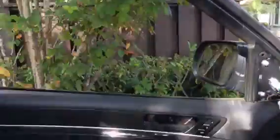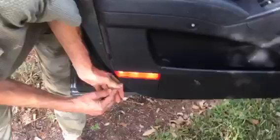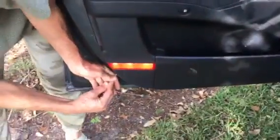That speaker comes off so you can lift the door panel. Take a screwdriver and pry the door panel off, then lift it up — there are little tabs behind there, you just got to get it started so you can get your fingers behind there. Just kind of pop them off, there are about eight or so tabs.